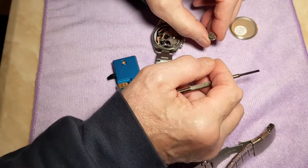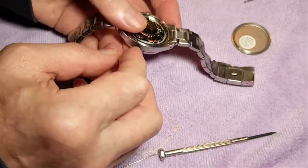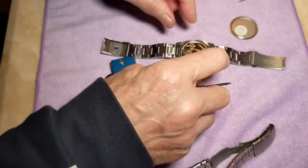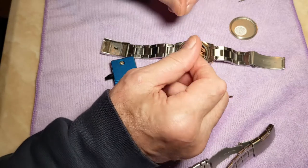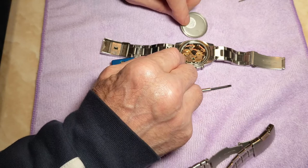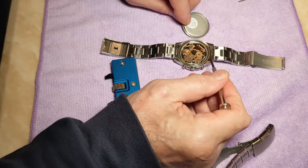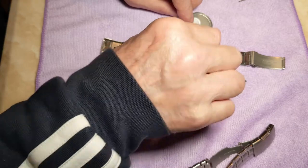It's very easy to put the battery back in — just slip it back under here. When you get your new battery, you shouldn't really touch either side of it because you don't want to leave finger residue on it. Ideally you should use gloves. You can shorten the life of the battery by touching it. Now, looking around here there's a little bit of dirt, so I'll get a cotton bud just to clean around there. Make sure you don't damage this rubber seal around the edge — that way you could lose your water resistance, so leave the rubber seal intact.